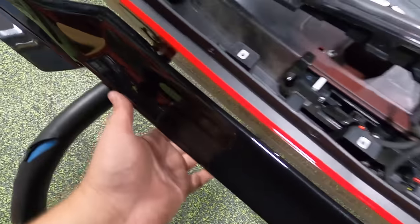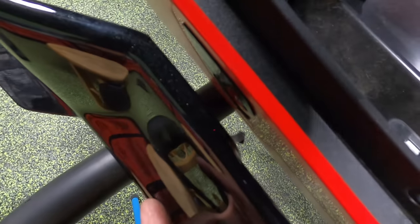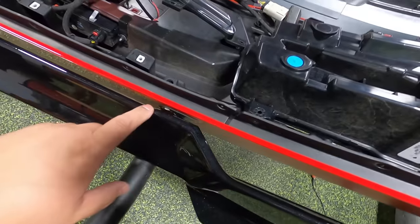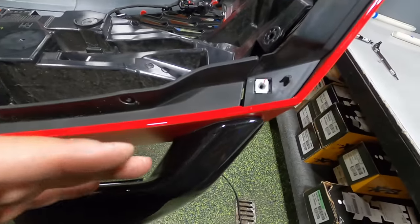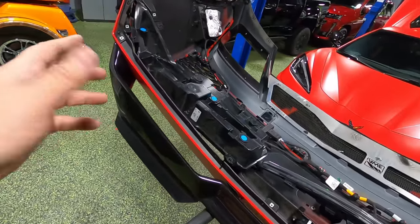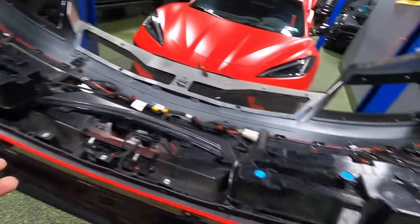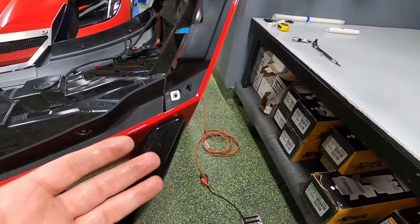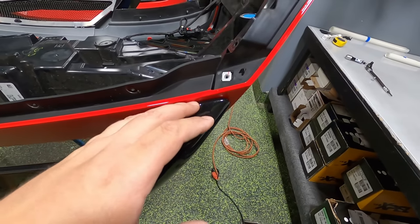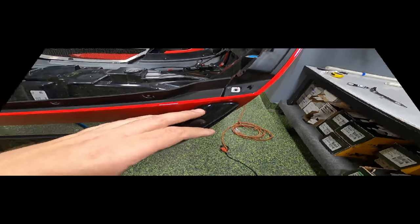So I got the two center posts off, as you can see here. There is definitely a good bit of double-sided tape there still stuck to the bumper we'll have to clean off later. This stuff is no joke — be prepared to have to kind of wrestle with this thing to get it off. These end pieces are going to be the ones with the strongest tape, so these are going to be the ones you really have to work on. I used a heat gun for a couple of minutes on it, but at the end of the day you're really just going to have to muscle this thing off.